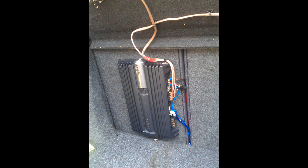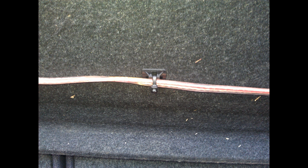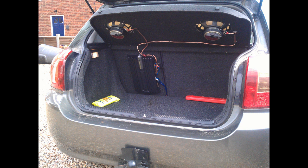What I did to tidy the cables away is I used cable tie bases. You can buy adhesive ones or velcro ones. The adhesive ones didn't stick to the carpet, so I peeled off the adhesive backing, leaving just the plastic exposed, and super glued them up onto the bottom of my parcel shelf — they worked perfectly and are not coming off. You just cable tie the cables up however you want, and they keep them nice and tidy and stop the cables hanging down. I also installed some spade connectors so I can take the parcel shelf out and it only takes a few seconds to push them back in.